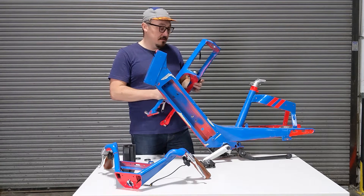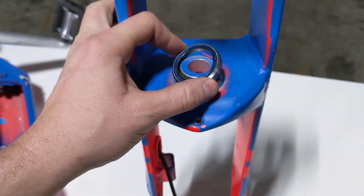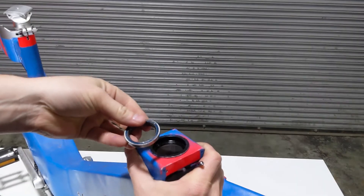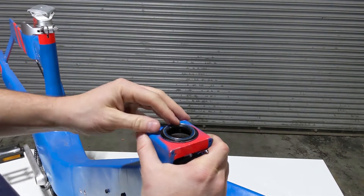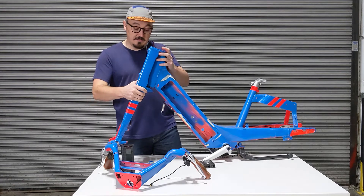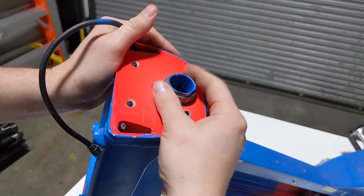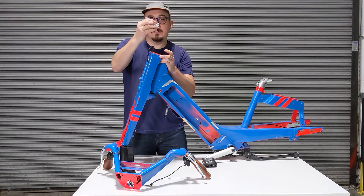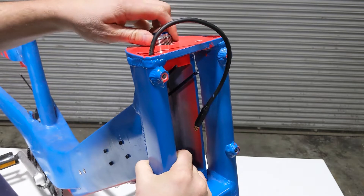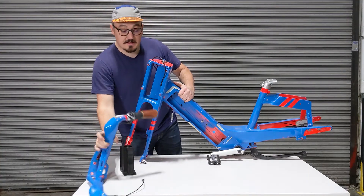Let's look at how this works and look at how another bike works. Essentially this has a kind of formed piece that acts like the crown race, and then the bearing will sit on top of that. And then in this head tube, which has a hollow member, it has recesses for the top and bottom bearings. The bottom has a recess for this bearing. You come in kind of underneath and then it slides over, and then it has this kind of a threaded head tube section that goes in and captures it off — acting like a reverse crown race with a taper. The top of this fork is threaded on this metal plate, and essentially you screw this all the way down and it captures the fork.